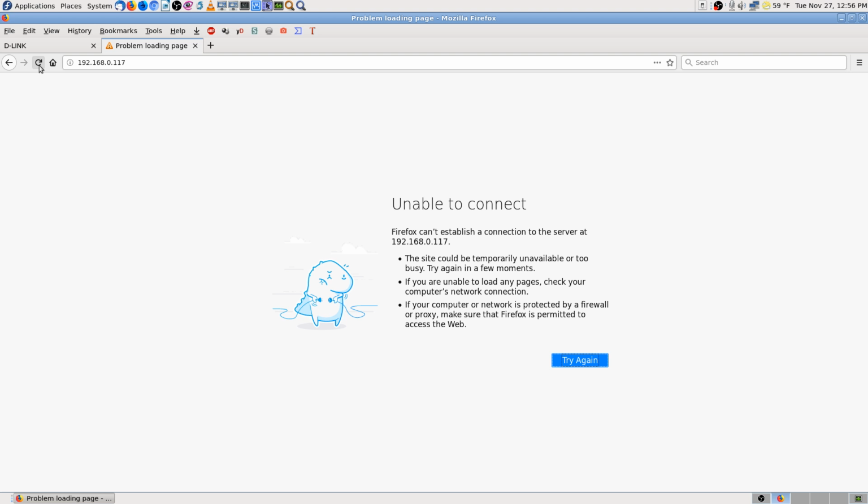I think I was going to be able to plug in one router and then have one port left. But now I realize, after all that studying and looking, I can't plug routers that are serving up IP addresses into it. Now wait, if I'm going to their uplink, yeah, that won't hurt anything. Never mind, because they have WAN ports. So if I'm going to the WAN port, that's good. That's fine. There's no problem. Okay.